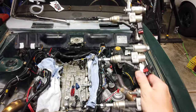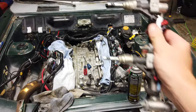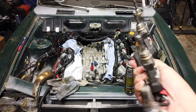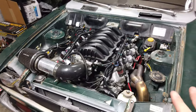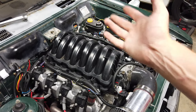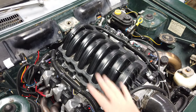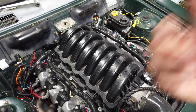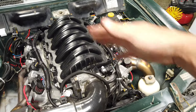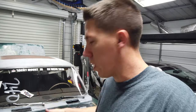The injectors are all reinstalled and I've cleaned out the injector holes as good as possible. Now we're going to try to put everything back in, bolt it down, reinstall, and see if it helped or fixed it. To get the other fuel rail in it didn't just slide into place — maybe it's because it's bent, maybe not. It looked like it was wanting to rub the nylon seal, so hopefully we didn't mess anything up. Worst case, I'll pull it back apart, reset the seals, and try to reset the rail.